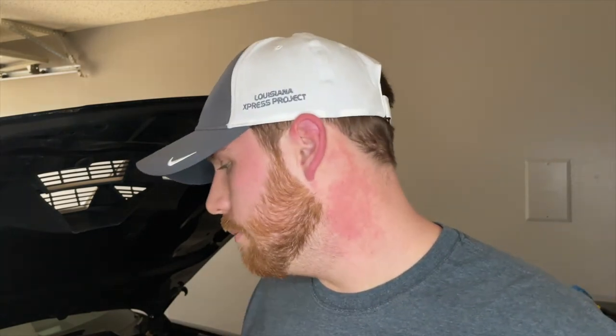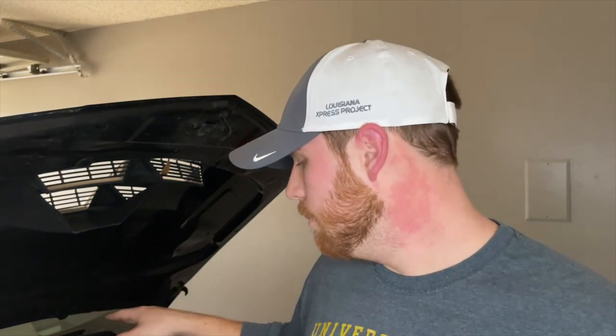So everything was pretty simple. It didn't take me a lot of time. The biggest thing was trying to diagnose what it was. I tried the spark plug, that wasn't it. Checked all the wiring, everything was good. And then I used that test that I saw from Chris Fix with a screwdriver, and listening to it, I noticed that there wasn't any ticking on the cylinder two fuel injector. So I figured that was the problem. Once I replaced it, everything was smooth.